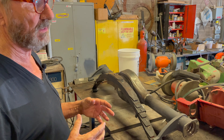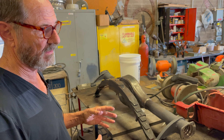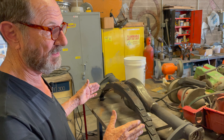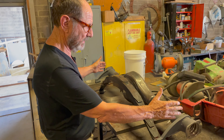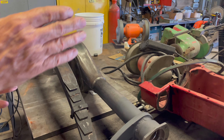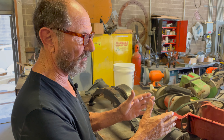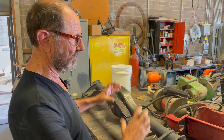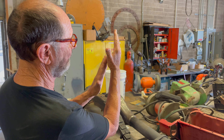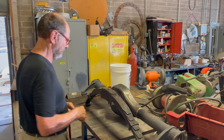You have to have a really intense understanding of the geometry of rear ends and front ends in order to accomplish this sort of thing and maintain the drivability of the car. This rear axle housing has to be the same width as stock, so we had to order it cut to an exact dimension. When we put the wheels and tires on it, we have to understand that the skirt is sitting right beyond that tire — that's a tight clearance. As this rear end goes up and down, it changes its relationship to the skirt, and if we get too close, it'll actually hit the skirt.